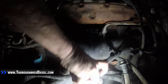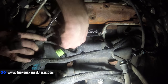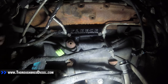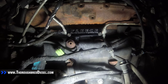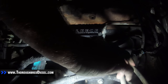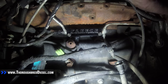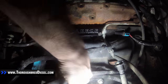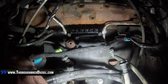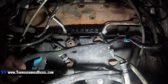We've got our water and fuel sensor hooked up. Now we're going to hook up the CP3 return line onto the banjo bolt — it's just slip it on and push it until it clicks, so we're good there. Everything else is done. There is the stock pressure line that comes from the tank — we're going to leave that there. The stock wire for the fuel heater, I'll zip tie that back here just to clean up the install. The two lines for the starter and the other wiring harness are already factory wires and not in the way of anything.